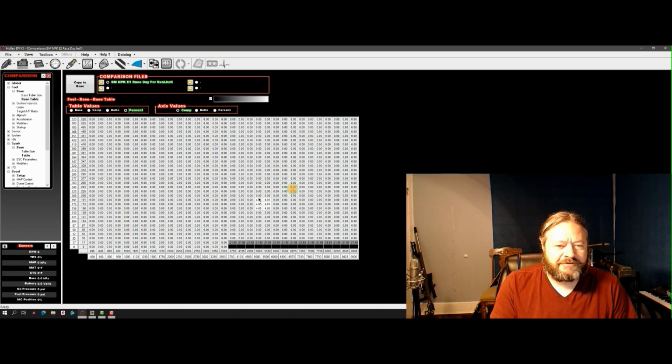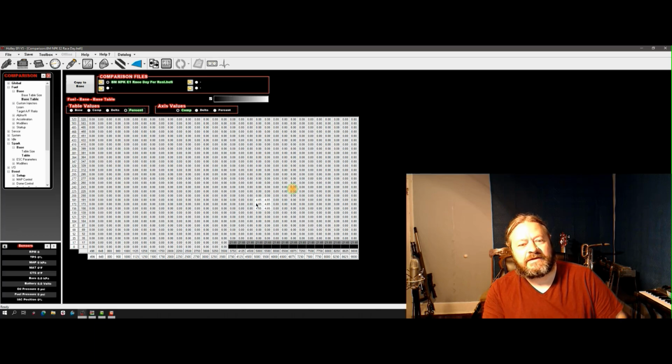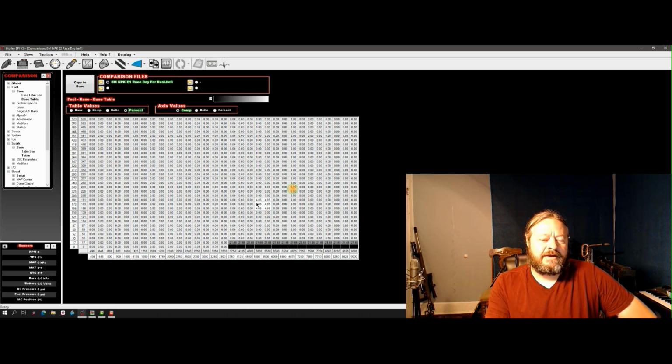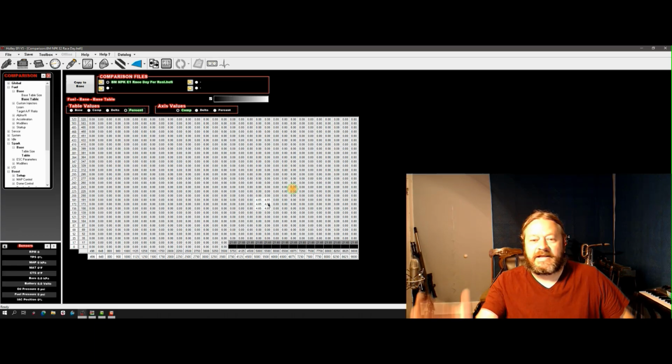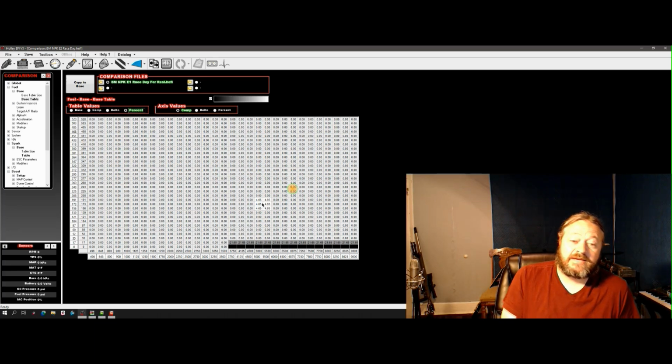This is often overlooked. Your air-fuel ratio in the 60, you've got to be careful there. You can make big improvements, or you can fix problems and accidentally add a lot of power. And you're like, oh, why'd I hammer the tire there all of a sudden? Well, because you took it from out left field to let's go. So you can do as much good or bad there as the boost controller. You have to be very constantly aware of that, and that changes day by day in some cases, especially these alcohol deals.